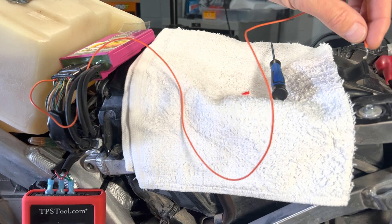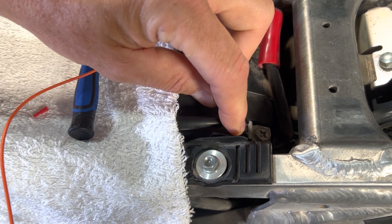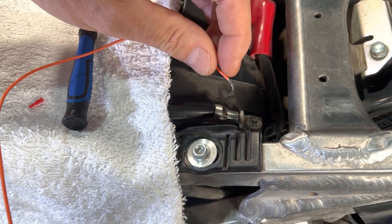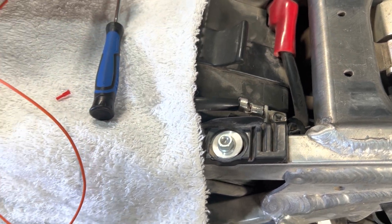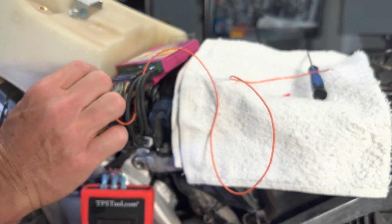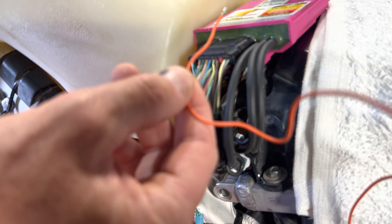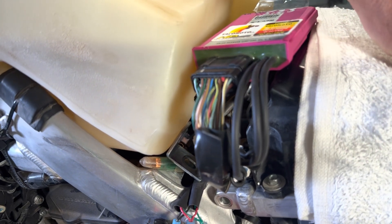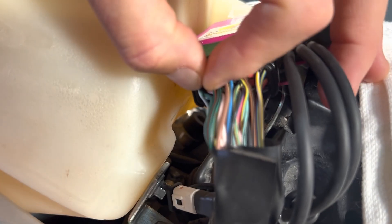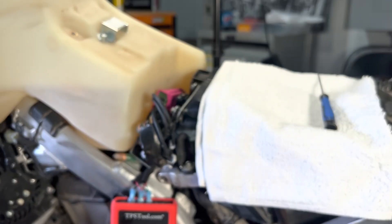The instructions are very clear: there are only three times you touch the battery. The first time, you touch and hold it while you toggle the switch to the run position. The other two times — zero percent and 100 percent — you just momentarily touch it. One note: if your check engine light does not respond to the trigger wire being touched to the negative battery, it's very likely the wire has not been pressed in far enough and is not touching the pin in the ECU. Now pull the wire out, plug back in the little dummy connector, make sure it's pressed in all the way, and reinstall whatever you've taken apart.